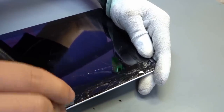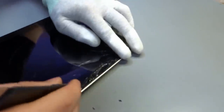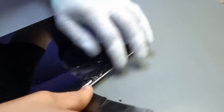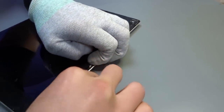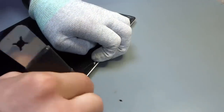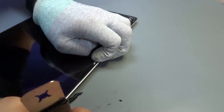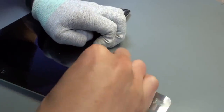We've warmed it in a temperature-controlled oven, but you can use a heat gun or hair dryer — though with those, the massive metal heat sink of the rear casing will sap all the heat away. You want the heat going through the glass and getting to that adhesive layer between the glass and the metal. It may feel warm to touch but still be stone cold where the glue is. If you're putting it somewhere warm — even a 20-25 degree airing cupboard — you need that heat soak to get the glue warm enough.